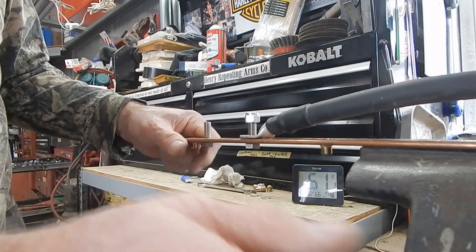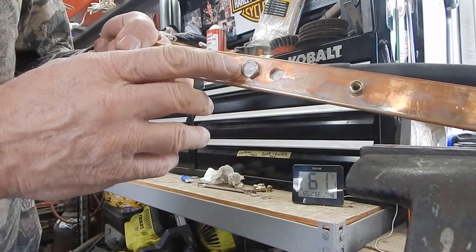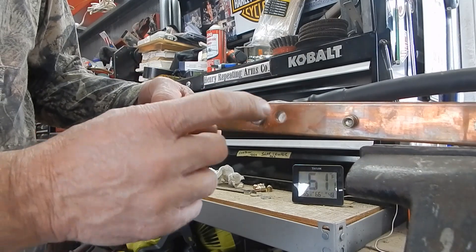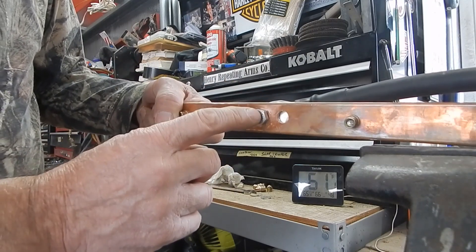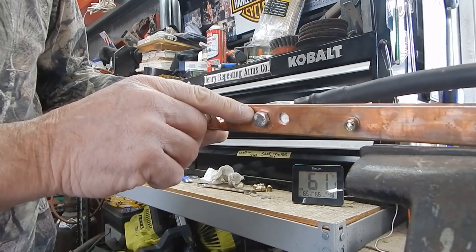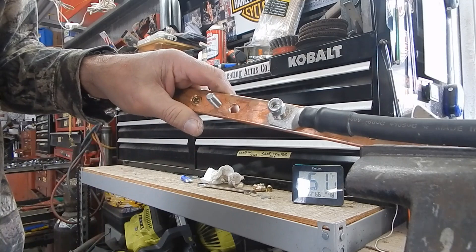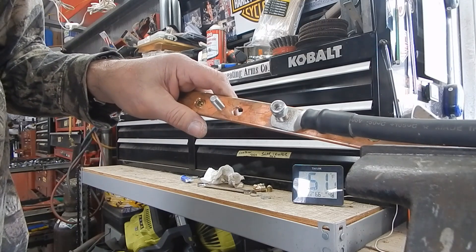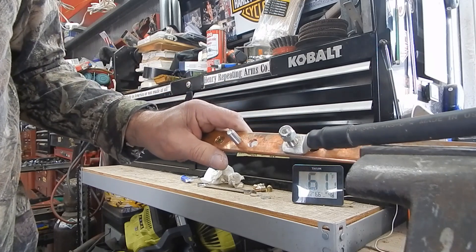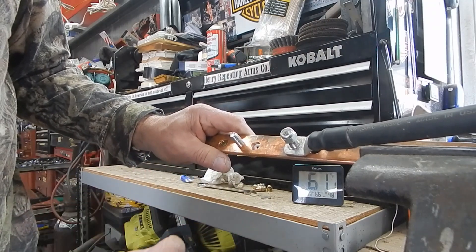So that's how I'm doing it — I'm just hoping this helps somebody. These were the factory jobs that just fell out. So if you tap it and use a bolt, you could probably use 5/16ths too, it would be okay. Just be careful you don't strip your copper — lock your bolt on the backside with red Loctite on the last few threads. Then you have a good contact surface for your lug and the bus bar. That's it for today's upgrade on the EG4 battery rack that came free when you bought three or more batteries. These apparently are the bus bars they sent to everybody.